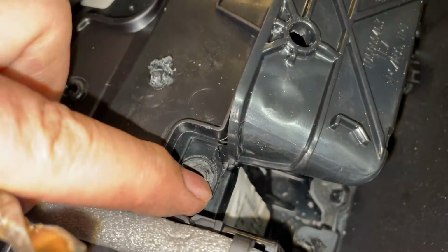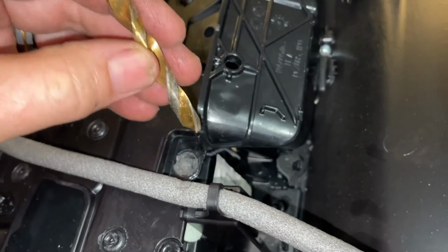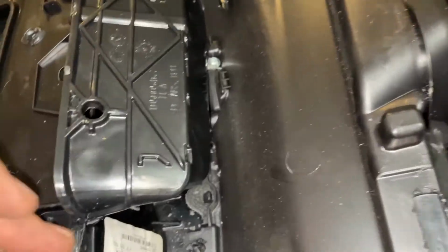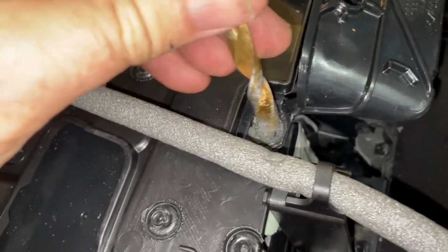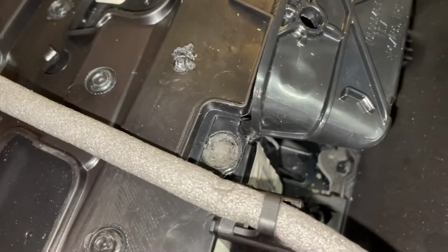So I'm drilling down with my big flat screw here, making some progress, chipping the edges off. I've got another drill. This is like a sharp drill. I didn't want to use the big one on that because they can bite and bite down. You've got to be very careful. But this one, you see, is about the size of the holes of the new one. So I don't mind about damaging this, but I don't want to make the hole here too big. So I'm going to drill down, now that I've got that big thing out of the way, with a drill that's about the right size and see if we can't find that hole.